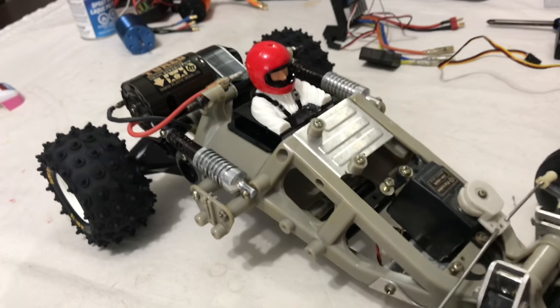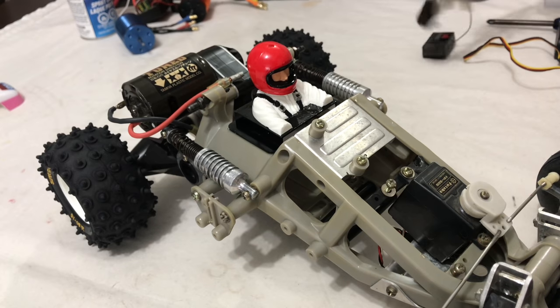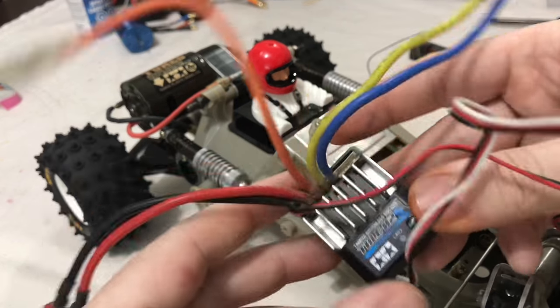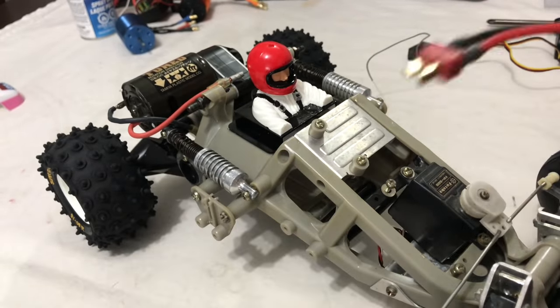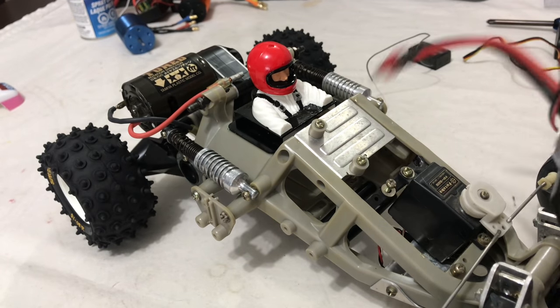The sports tuned is in, I've just got the grease around it, it feels nice and smooth. So this is the metal plate I was talking about. I've lost a Hobbywing 1060 somewhere — I've got two of them. One's got Dean's connectors, one's got a Tamiya connector. So I'm just going to use the Tamiya TBLE02S. This one's got a Dean's connector fitted already. That's got a 23-turn limit, but it's not got a massive current draw motor, so this will run it no problem.